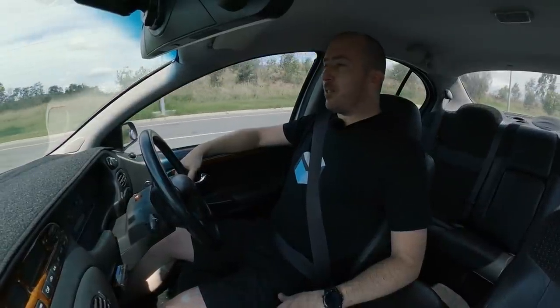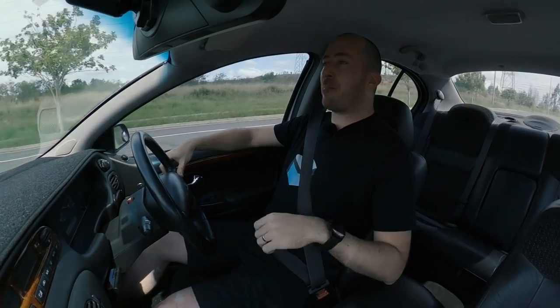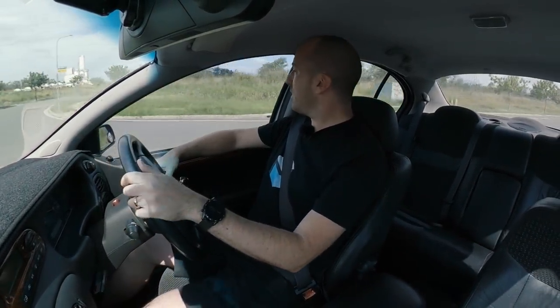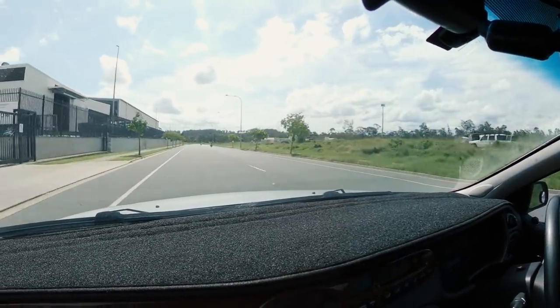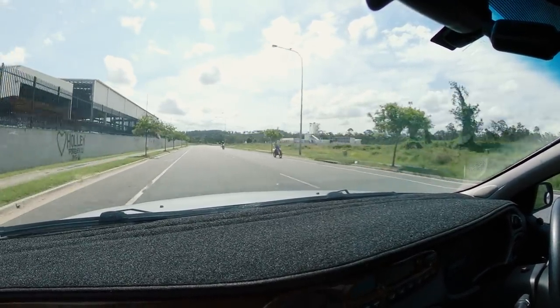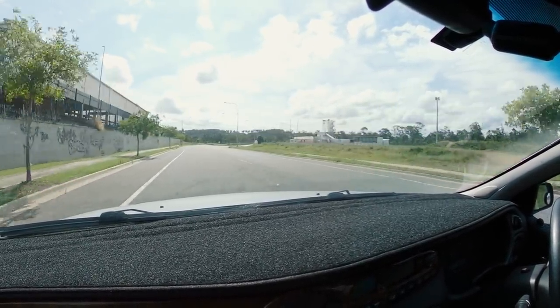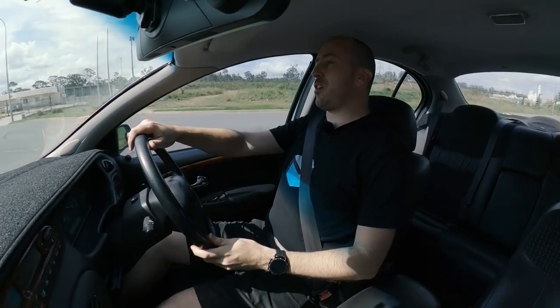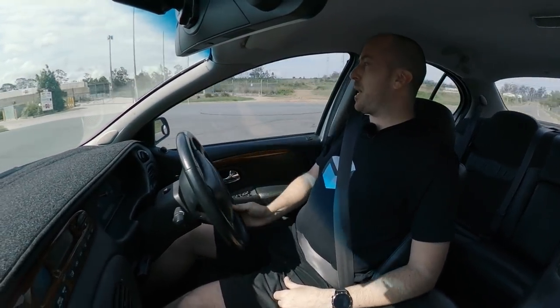So look, your mileage may vary. I do have a new sump, a filler bolt for that gearbox on order, and when it turns up, I will replace it. And I also do have a fitting for the transcooler as well. You'll notice that I sort of yeeted that line onto that existing flared end of the hard pipe. I will be replacing that with a proper barb fitting as well, just like that was included in the kit. But yeah, that's on order as well. Hasn't turned up yet, but it's not leaking, luckily. So it's gonna do the job until that barb fitting turns up.